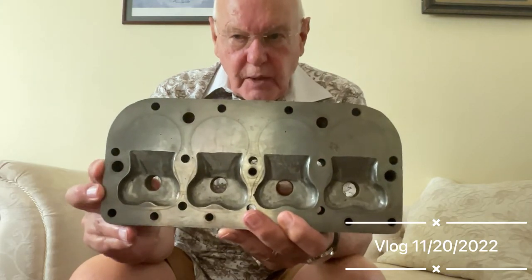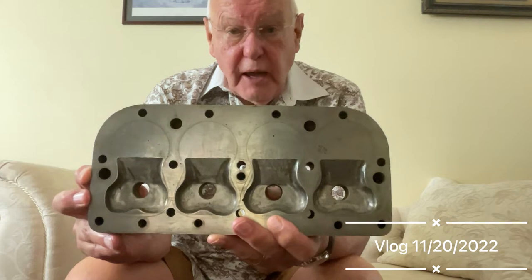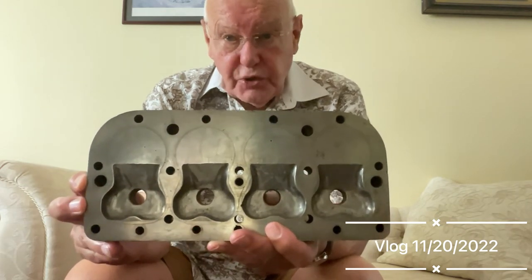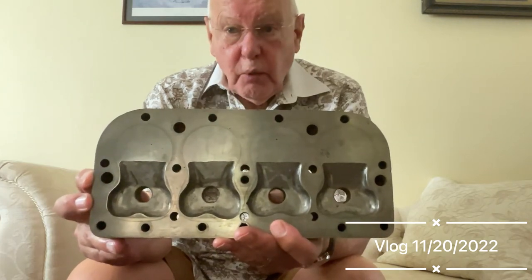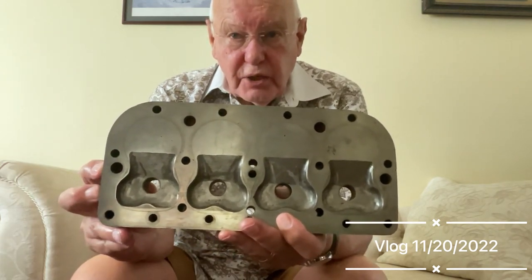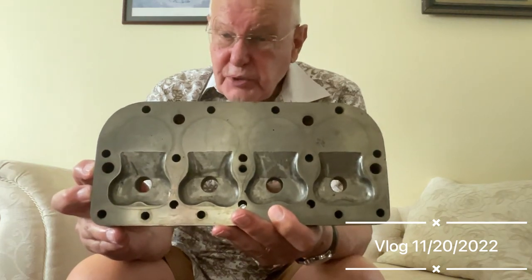There's a great misconception that an aluminium cylinder head will give you more power than an iron one, and that is simply not true. The aluminium takes the heat away from the cylinders very much more quickly than iron because the conductivity of aluminium is much greater. We found this out back in the 60s when racing 1172s, using aquaplane aluminium cylinder heads, and found that an iron head — especially with this type of design — gave about 10 or 15 percent more power.